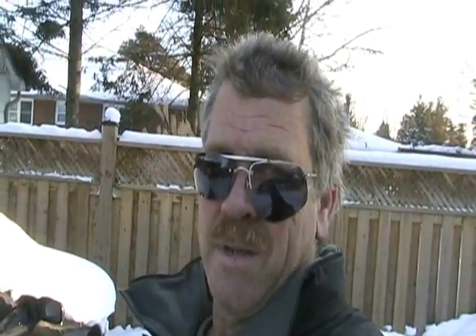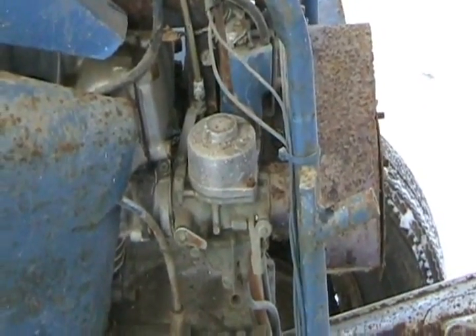When I made this thing back in 1977 in high school, the motor I used was a Honda — something like a CB450, I can't remember the exact model name. But it was called the Hellcat engine because they had two versions of that engine back then; this was the race version. It had dual overhead cams — back then only two valves per cylinder. It was probably the most advanced motorcycle four-stroke engine there was at that time. Its redline was 10,500. It didn't even use valve springs — it used torsion bars to lift the valves instead of springs. A pair of Keihin constant-velocity carburetors.